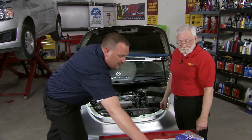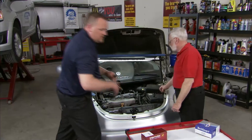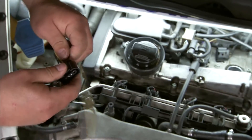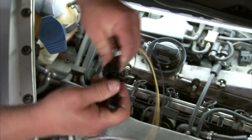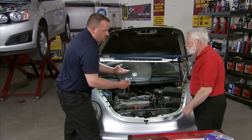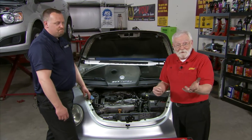Well, we have a line called TechSmart, which is a problem-solving solution line, and we've got a pigtail connector specifically for this application. We can go a couple of different ways: depending on whether the electrical terminals are okay, the technician can use the tool that comes with the kit to release the terminals, back them out, and use the original wiring with a new plastic connector — or simply cut the wires and splice them back in. I love that the tool comes with the kit, because it's so much easier to just replace that busted-up connector.